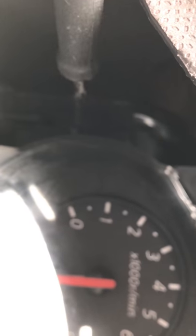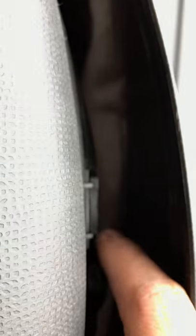Now we've basically got straight to the instrument cluster. Apologies about the camera quality. There's going to be a screw here, and there's also going to be another one on the exact opposite side. Once you've got those two unscrewed, the speedometer still won't move because there's one more screw on top — right where my finger is. I've already removed it. I used a socket wrench with a Phillips bit in the end and it was pretty easy.